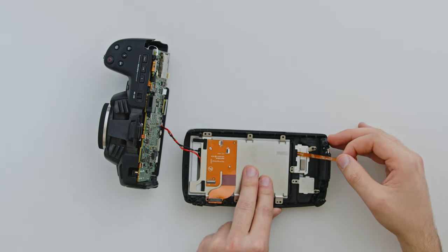If you're ready to reassemble a Pocket 6K only, start by finding the smaller top cover part. This needs to slot down behind the tilt hinge — it has two small clips that have to slide in beneath the back half of the camera enclosure before it can tilt into position. Use the two small bolts from your first container with the small Phillips head screwdriver to secure this small plastic panel. The small bolts go into the two outermost holes, while two of the six larger T6 Torx bolts fill the two innermost holes. For both Pocket 4K and 6K, reinstall the four remaining bolts into these positions — there will actually be two bolts left over from the Pocket 4K install that you won't be needing.